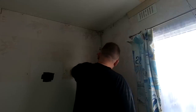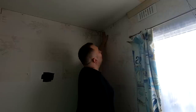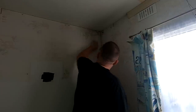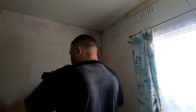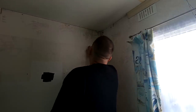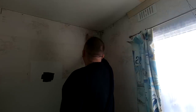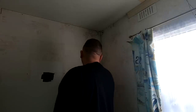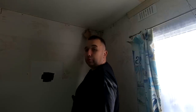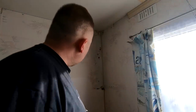None of this feels wet on this side, which I'm hoping means we've got away without damaging that. But this top bit is definitely no good. I actually have got a sheet that will replace this whole sheet if we need to go down that route. But what I'm going to do — there's a stud behind here — I think I'm just going to cut a sliver out of here along this stud, and we'll see if we can just manage it. If I can find the middle of the stud we might get away without replacing the whole sheet and can just rejoin on the stud.